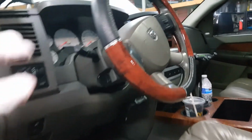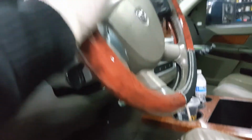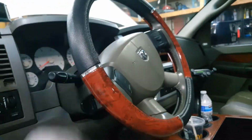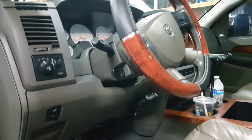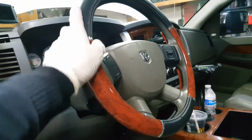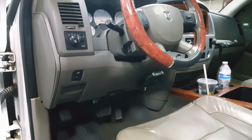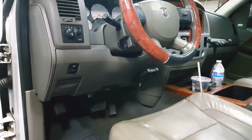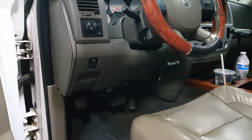The problem I have is a little bit of a popping sound. As you turn or go over small bumps, there's a little roughness to the wheel. You can almost just feel it through your brake and even your accelerator pedal, somewhat on the floor sometimes. It's not super bad, but there's definitely something there. I can even feel some vibration at certain speeds. It's definitely that popping sound that's mostly bothersome on this, and it's not there all the time. Like I said, you can feel it in the pedals sometimes.